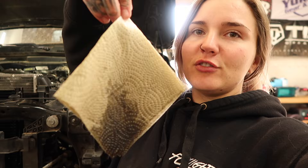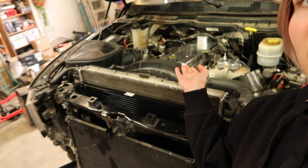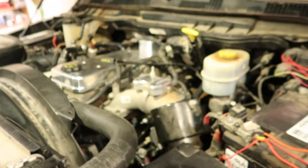After doing the Spilab valve cover at around 1200 RPMs for another 15 to 20 minutes to get to running temperature, it soaked all the way through the paper towel and made a gigantic mess in the engine bay. That pretty much solidified the issues with the Spilab valve cover — they don't have an internal baffled system. Because the catch can kind of restricts airflow, I went ahead and put the DNJ valve cover on and tested that one.